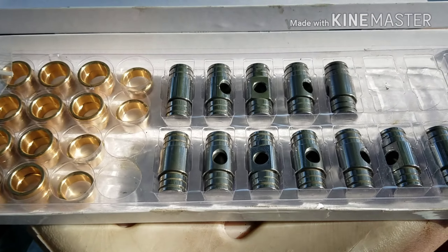Nice and easy. I'll come with the handle just to make sure it's jammed in there tight. I got the 7/8 socket on this side and the 5/8 socket pressing against the bushing — easy, just doing it by hand. When it gets down tight, I go ahead and use the handle. Nice and easy, no forcing. Boom, that's it.